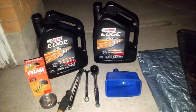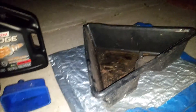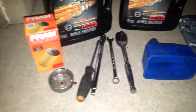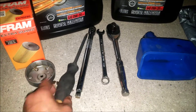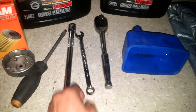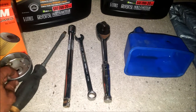So these are the things you're going to need to complete this oil change. You're going to want probably a tarp, definitely an oil catch container, a funnel, this oil filter cartridge socket, a flathead screwdriver, a half-inch drive extension, a 14mm wrench, and your half-inch drive ratchet for that extension and filter.